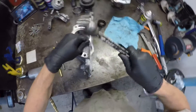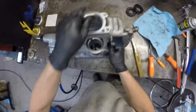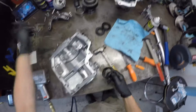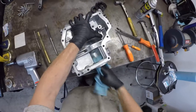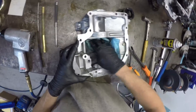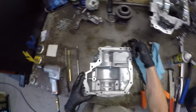Your seals are all out. Give your case a quick wipe, or if you want, run it through a parts wash bath — make sure it's clean. This one's already been cleaned. Also what I like to do is sand the outside of my mating faces with 600 grit sandpaper.